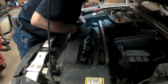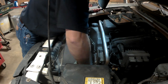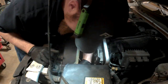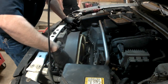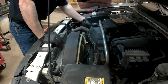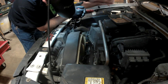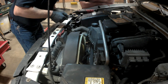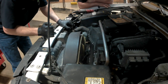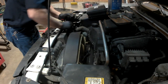Most of the reassembly I'm going to move through quickly. There are two pins on the bottom of the fan shroud that go into the radiator — that's what retains it — and they can be a little tricky to get lined up. Once you get them lined up, spin your fan back on. It's not really necessary to torque the fan down — they thread on opposite to the direction the engine rotates, so if you were to hold that fan and start the vehicle it would thread on tight. The resistance of the fan spinning will actually tighten it up on the front of the water pump.